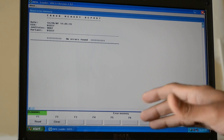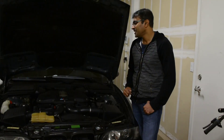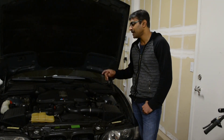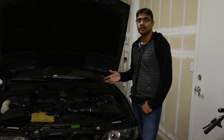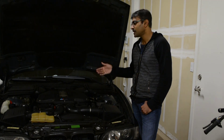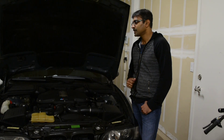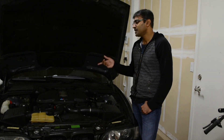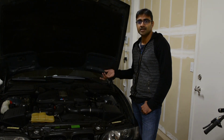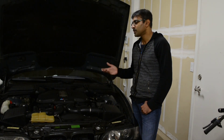Finally, we are at the conclusion part of this video. I was able to resolve this issue. Apparently this is a very common issue for almost all E39 BMWs. The primary reason is that the ABS controller circuit board is located very near to the exhaust side of the engine. Over years of constant heat cycles, the solder joints can give away. In my case it was the brake pressure sensor's solder joint that had failed, but it could be any other input like the wheel speed sensor. Depending on that, you could get different types of errors, but the troubleshooting process itself will be closely similar.